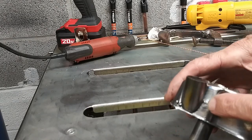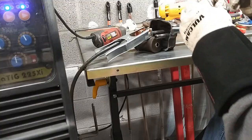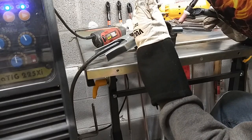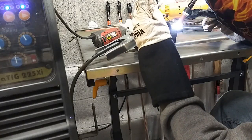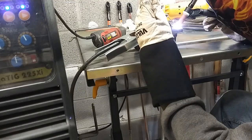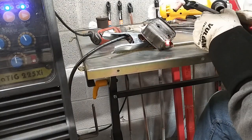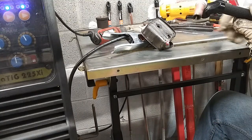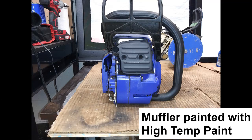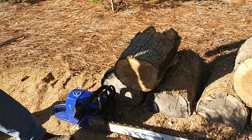That's my new exhaust port. It will be 70% of the area that the exhaust port has — if the exhaust port is 100% area, that muffler exhaust port will be 70% of the exhaust port area coming off the engine. I had it tack welded when showing you earlier; now I'm finishing the welds all the way around. We're not going to show every bit of the welding process. Once done, I'm cooling it off with a bit of air. That port is pretty well intact — I damaged one small corner, but this is the final product. It's a fairly clean installation, very similar to the original except the exhaust is now at the front.